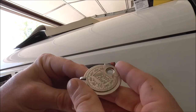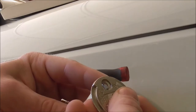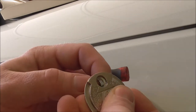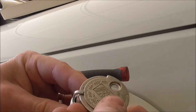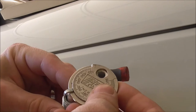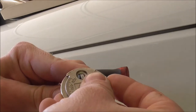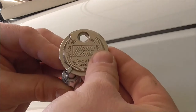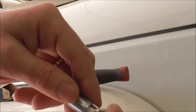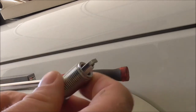Looks like this one's a little tight, so we're going to open it up just a hair. Take that lip right there and very gently bend it up — a little goes a long way. Recheck it — that's about .049 now. I'll do a little more to get it toward .050. If you happen to spread it too much, just take the end and push down on it. Pretty simple — just verify your gaps and make sure that's all set.